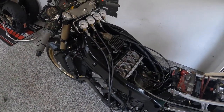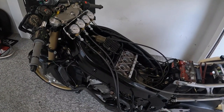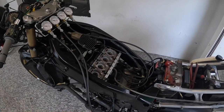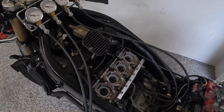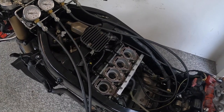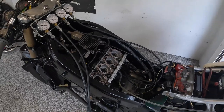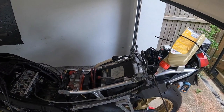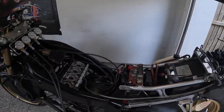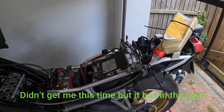There we have it, guys. That's the set of carburettors balanced. Quite a nice, easy set to adjust, to be honest. Started up lovely, and because they were set fairly well to begin with, it was only minor adjustment once up to operating temperature. But another quick tip is, just when you're doing this, if you do have a temporary fuel connection on it like this, if you start getting it misfiring or rough running, don't forget to check the fuel level, because it may have been running low.